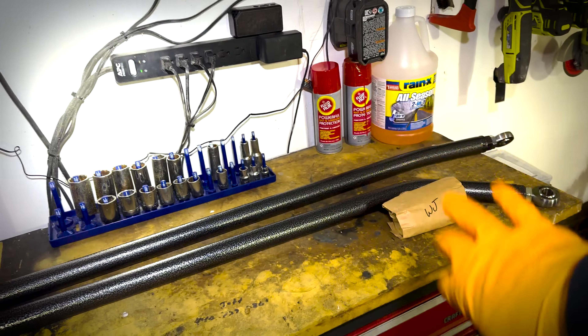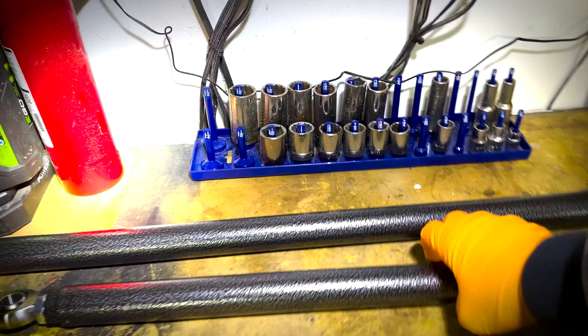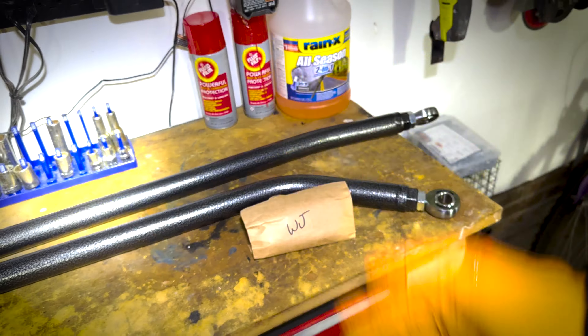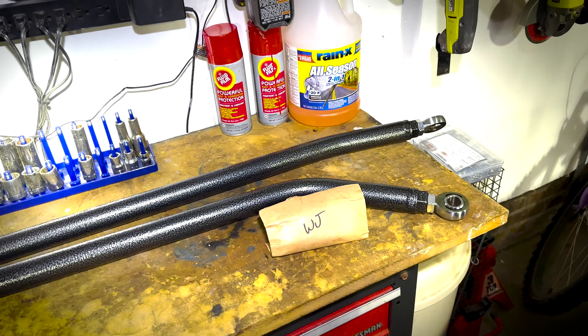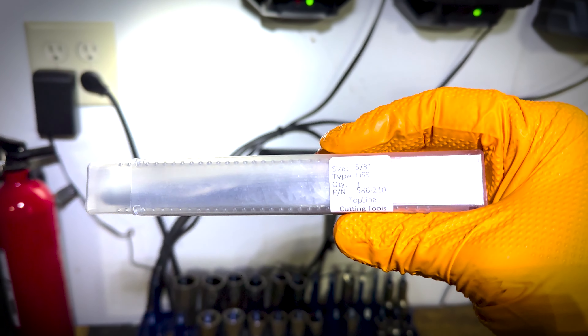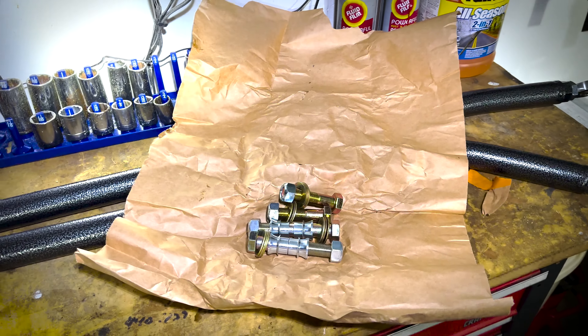This is the stuff that you get from the Trail Forge kit. Not pictured is they also send you some candies and some stickers — way more upgraded, beefier parts. Just the overall diameter of it, with a very nice powder-coated finish. You get all the bolts included that are needed. There is some drilling required — you just have to drill out what's on the knuckles and on the pitman arm so you can accept the new grade 8 bolts. The new size you're going up to is 5/8. You can buy the reaming tool directly from Trail Forge, and they go ahead and put together all your nuts, bolts, and everything else required, so they make it pretty easy.